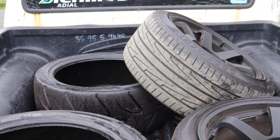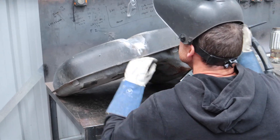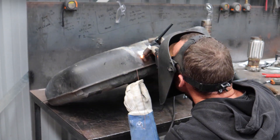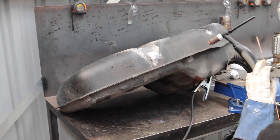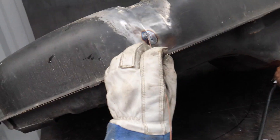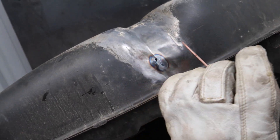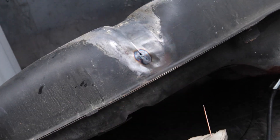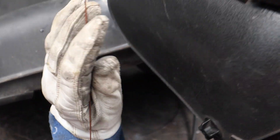That's what we're up to today — we'll get that tank welded. So it's kind of like a splitter and it heads up. You can see it's cracked here, but either side of the crack is just so thin. So that's why I just want to melt it away first to get to a more solid area, and then I can just weld it over the top of it. It kind of almost looks like there's a line heading there as well — might be a scratch though.